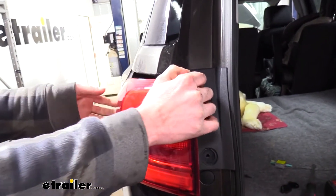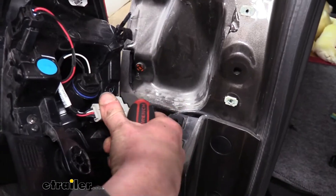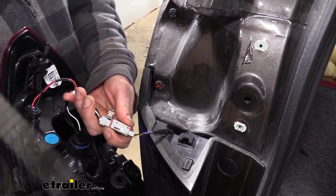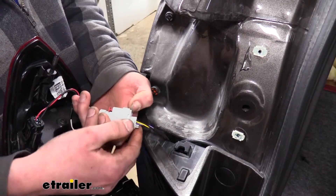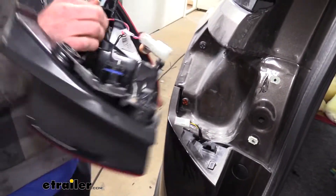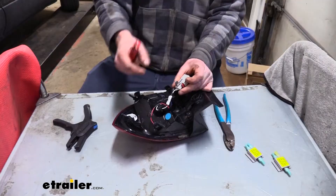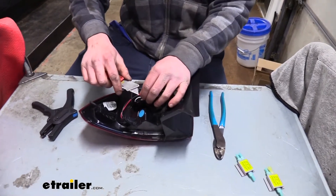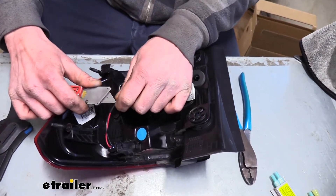Once you've got it popped loose, there's a connector behind it. This connector is typically attached right here — sometimes it may have fallen off. We want to pull it off regardless, so if it is down there just give it a little tug and pull it off. Then we can remove the lock tab using our flat-bladed screwdriver to pop that up, and then we can push on the release tab and disconnect the connector. Now that we've got our taillight assembly removed, we can take both the driver and passenger side over to our workbench where we'll install our diodes. We're going to be tapping into the red wire and the white wire, so we'll cut off the little pieces of electrical tape that are holding them together.